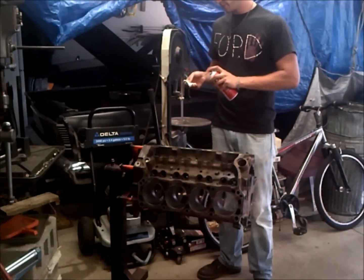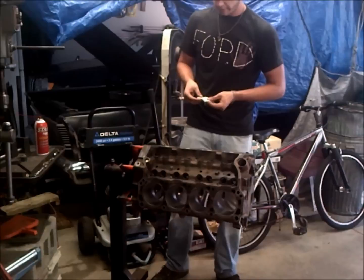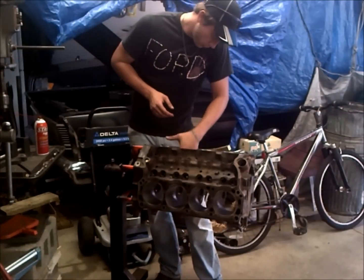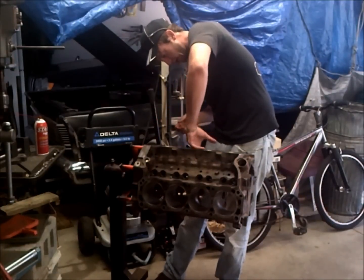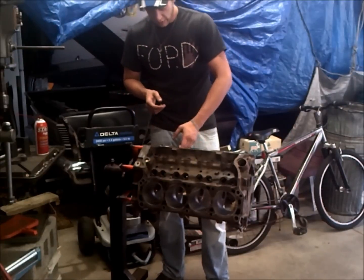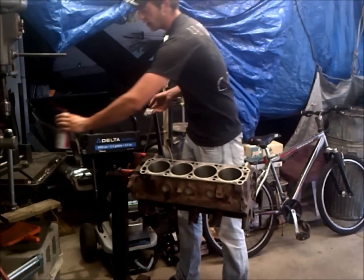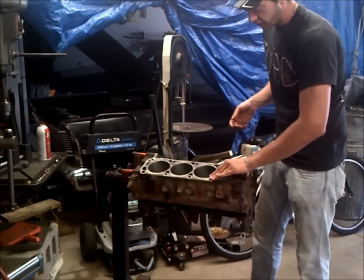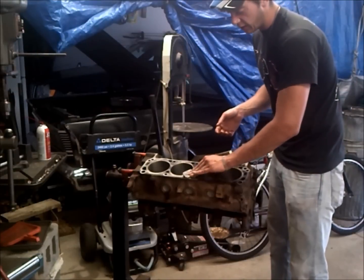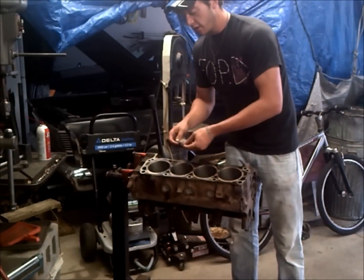Finally, add an oil to stabilize the metal from rusting — apply it to a rag first and rub it around every bore and every surface you don't want to rust and aren't going to paint. It should all stay good until assembly. In places such as where your head gasket seats, put foil on that so it doesn't rust. Keep in mind that when you go to assemble your engine, you don't want this oil on there, so use a solvent such as carb cleaner to get all this oil off before you assemble your motor. But this helps it keep until you're ready for assembly.